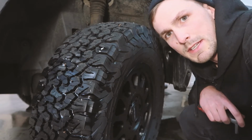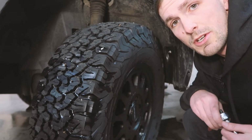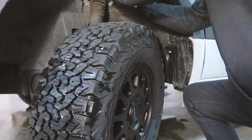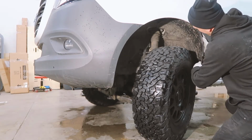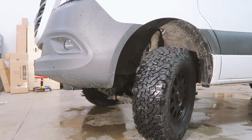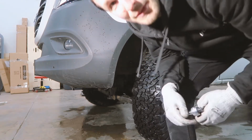The next step is to take out the inner fender liner here, and there's two more 10mm bolts. We'll just use our ratchet here and we'll get those right off. We missed a bolt. That's why it won't come off. So scratch that. There's not two, but there's 3 10mm, and that's what holds it on. So, my bad.